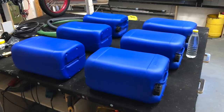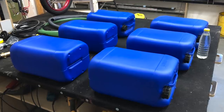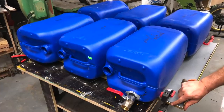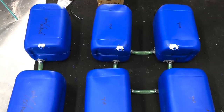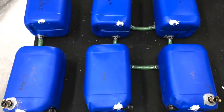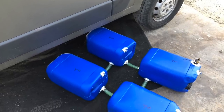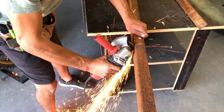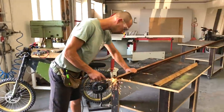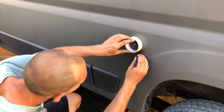There are plenty of pre-made campervan water tanks, but I personally would never put a water tank inside the car if there's an option to have them underneath — space saving is the reason. I'm on a tight budget so I'm building my own tanks out of barrels, connecting four 25-liter barrels to create a 100-liter fresh water tank, and another two to make a 50-liter gray water tank. These barrels fit perfectly under the car, and I welded a supporting frame so the tanks are covered, protected, and pushed hard against the car from the bottom.